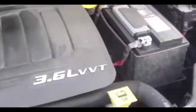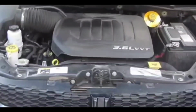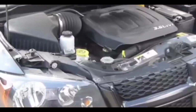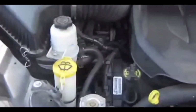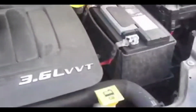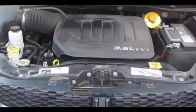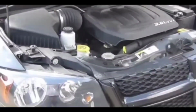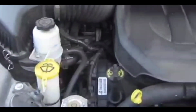It's not the most difficult situation to diagnose. There's only a certain amount of things that could cause it, and 99% of the time it's a power issue, either with the battery or not, or for whatever reason the starter is just not getting enough power to actually generate the speed it needs to have a normal crank. But if it cranks over and your engine starts up, you guys really don't need to worry about trying to figure out whether it's something more complicated, whether it's something more mechanical, etc.